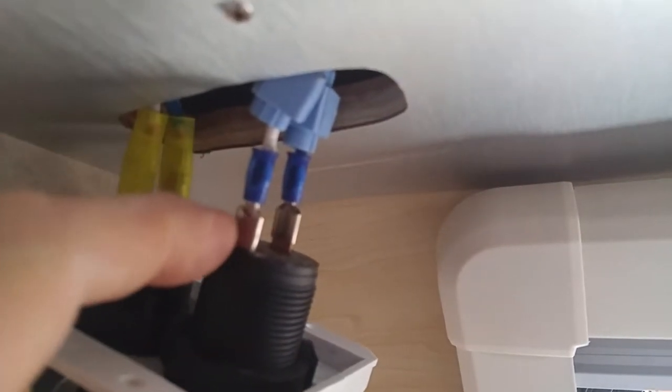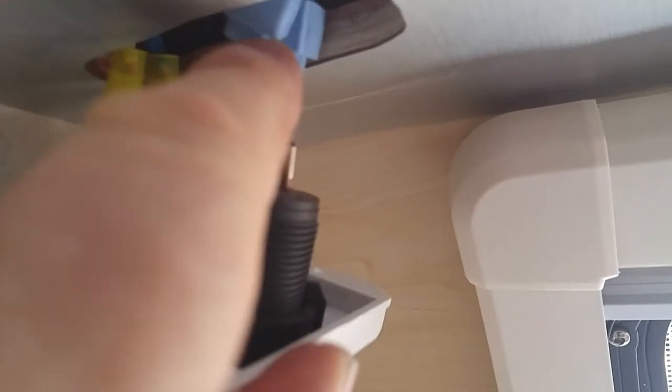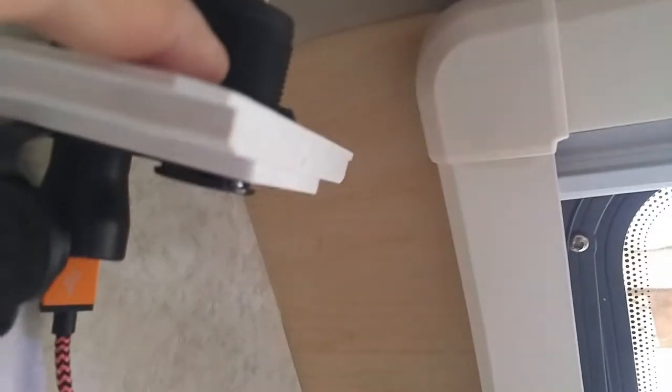Once you take those screws off, you can pull this down and you can see the wiring that's going on there. They're just typical clips. This will be negative on the white wire, that'll be positive on the blue wire. You can see they've got those taps. I don't like those things. The wire will come in here, drop down, come up, drop down here, come up. They're just using the taps to tap multiple devices into the same circuit. So they're not great. So it may be that this charger circuit is okay, but the supply leading to it is not.